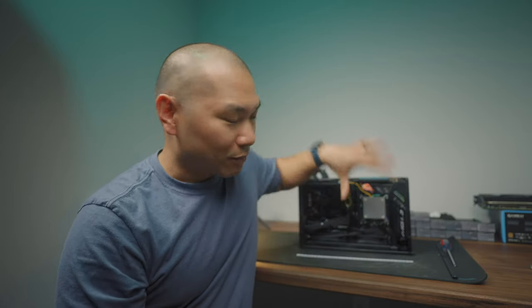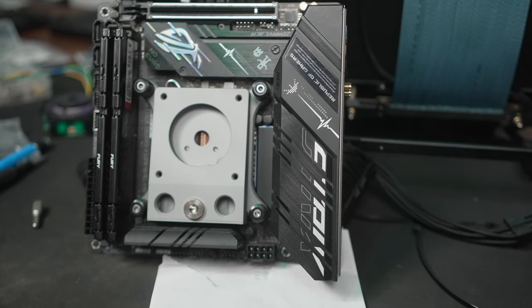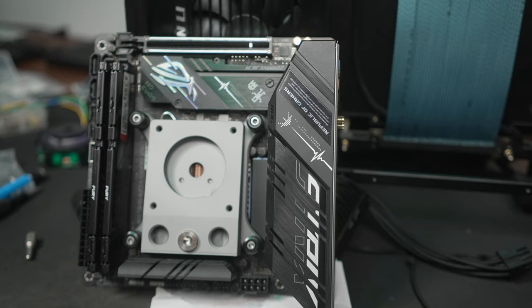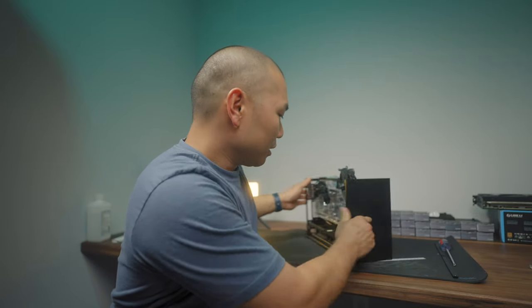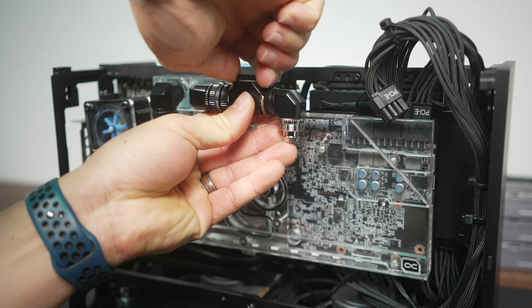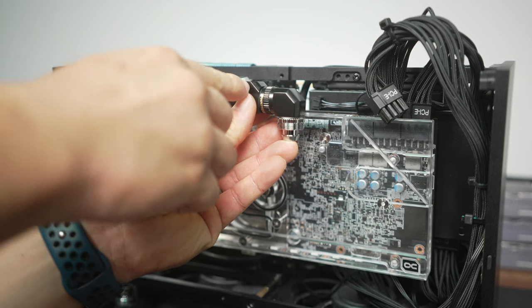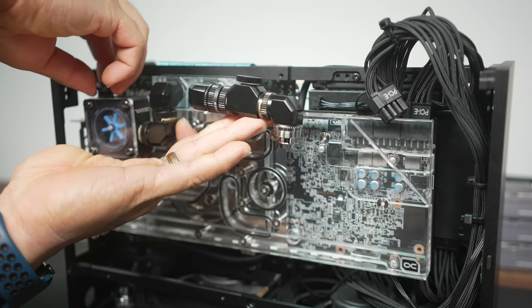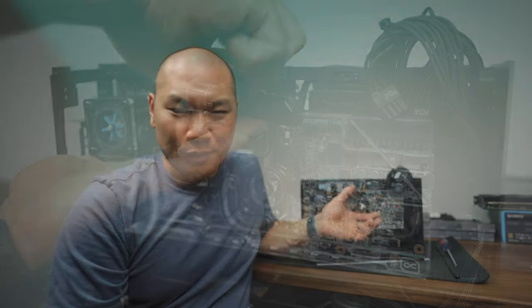The last consideration is filling, bleeding, draining — maintaining the loop. Eventually this is going to flip the other way around with the radiator on top for airflow, but it doesn't matter during filling or maintenance, you can turn it any side you like. One of the big problems with a CPU pump block combo is filling it — it's not an optimal location to fill without a longer fill tube, and bleeding out the air is really a headache. So I wanted to avoid all that. The simplest solution is to work up an ensemble at the top on the GPU side that can easily be accessed, with a location to bleed out displaced air easily. I'm using a T splitter with a stop fitting — I can just unthread this fitting during maintenance or filling, open up the top of the flow indicator, and I've got all I need to fill it up without too much trouble. It does require a few more fittings, but it'll be worth it long term.